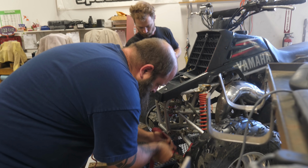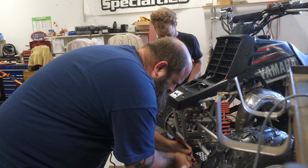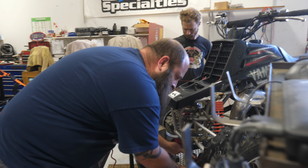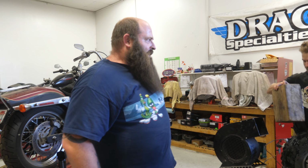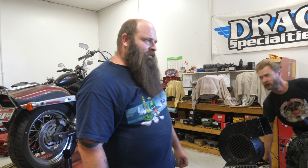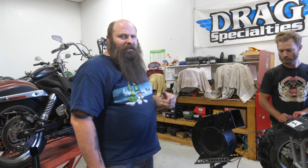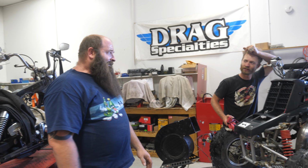So we brought you your first Barbie Jeep, but is this your first quad? Yeah, I think so. And certainly the first two-stroke. I'm kind of curious to see how the air fuel gauge works with some two-stroke oil in it. I don't know if we'll get an accurate number there. I'm also interested to see what the TAC has to say about the two-stroke thing too, because I don't know that there's a setting in there to set it up for two-stroke. So we might get some really weird numbers. Yeah, that could be really weird.